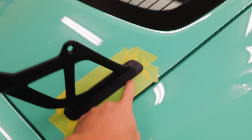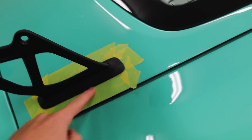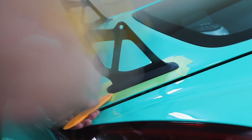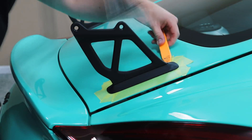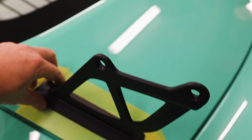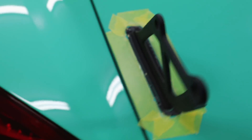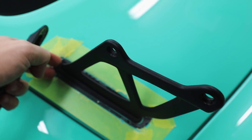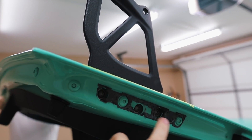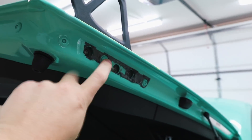Wing is off. I have this taped up here — we're going to take a heat gun like we did earlier, heat up this area, get our pry tool under here to avoid scratching anything. Work around it, get this sleeve pulled off, then prop this up and take those bolts out. When you have it all loose from heating, pull this up and wiggle it off. Once you take that off, there's a rubber gasket in here — keep this and reuse it on the new uprights. Then pull these three bolts out and we'll be ready to clean up and put the new ones in.